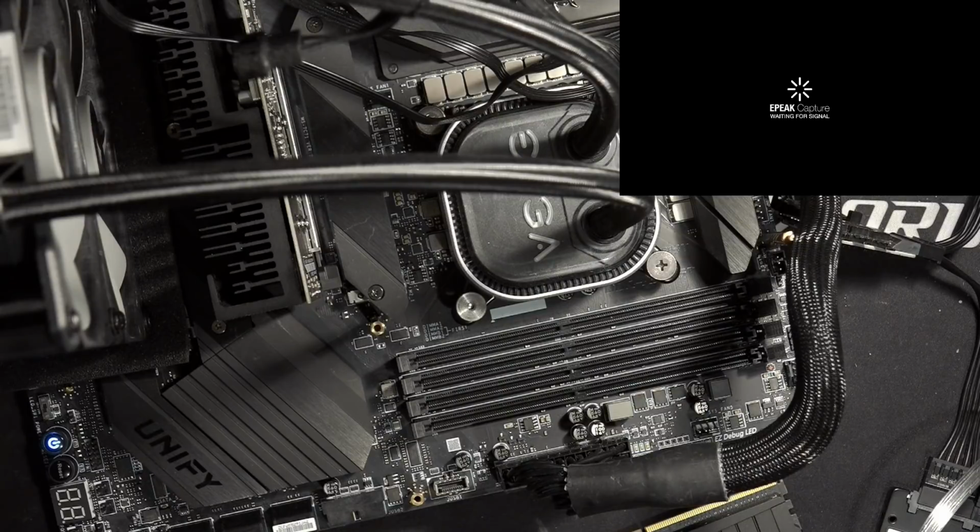You can also just factor in the fact that now there's half as many big BGA components, right? It simplifies the manufacturing process. So single rank 16 gigs right now, it might depend on the brand as well, but it should generally be starting to be getting cheaper. So if you're thinking of picking up a 16 gig DIMM to get dual rank, it's probably not going to work now. If you did it last year, it would have worked just fine.